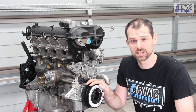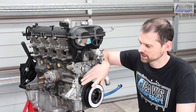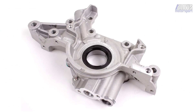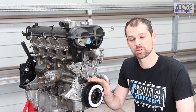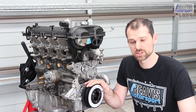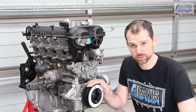The Boundary pump gears are machined to very high tolerances and are a perfect fit inside the OEM casting, which is also supplied brand new from Boundary Engineering. However, there are a few different configurations to be aware of. The non-VVT version of the pump comes with standard sized gears, but still upgraded performance — they're much stronger — and you can choose from a few different shim options to increase your peak oil pressure.